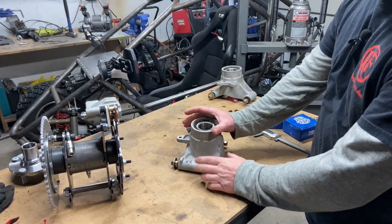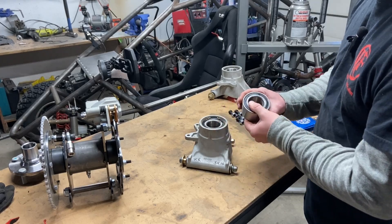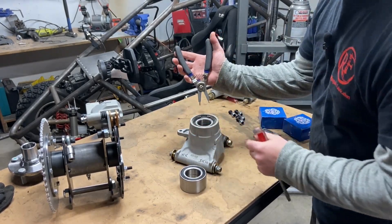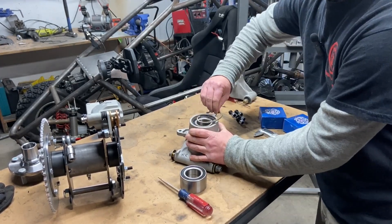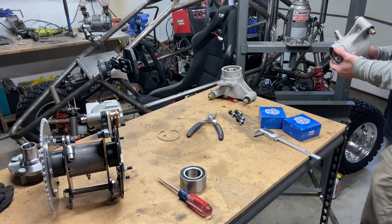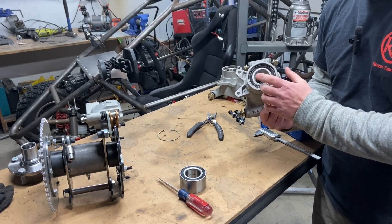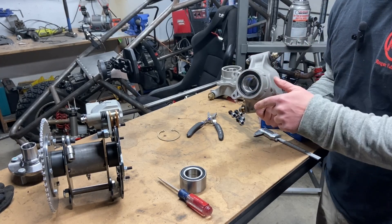These are used hubs. This bearing could be the right size, but this was the one prescribed by JD's Garage to press in to use Miata axles — big shout out to those guys. It's just safe to replace this bearing. You'll need a special tool; I picked this up at Napa on the cheap. Definitely wear safety glasses and take your time. The first time I needed to change a bearing, you have the choice of buying a new hub for $100 or getting a $10–$20 bearing and replacing it. It didn't take long to figure out I'd make my money back quickly by just buying a press.